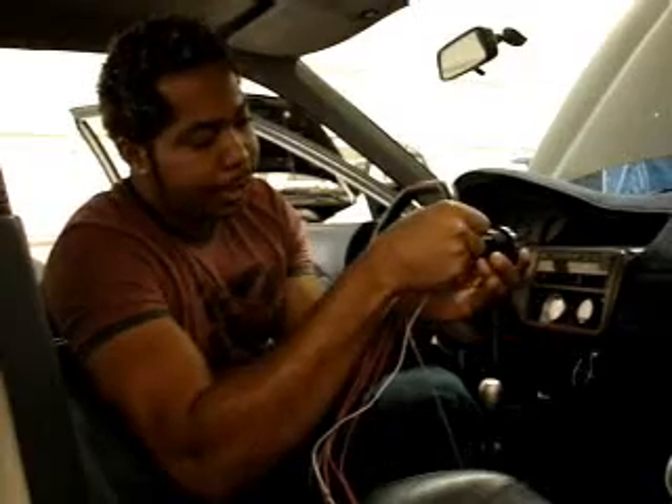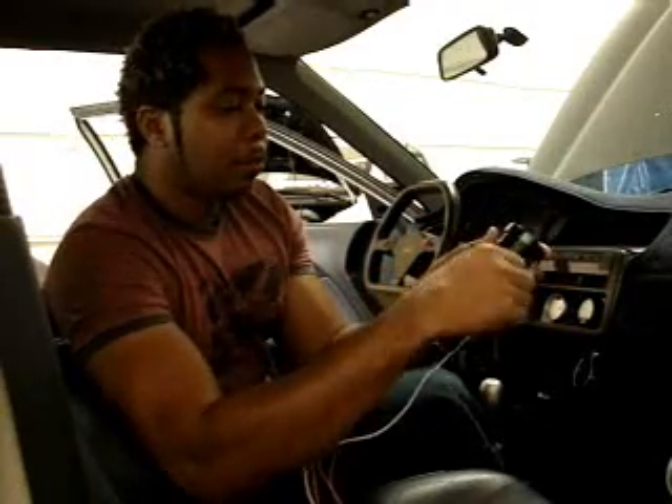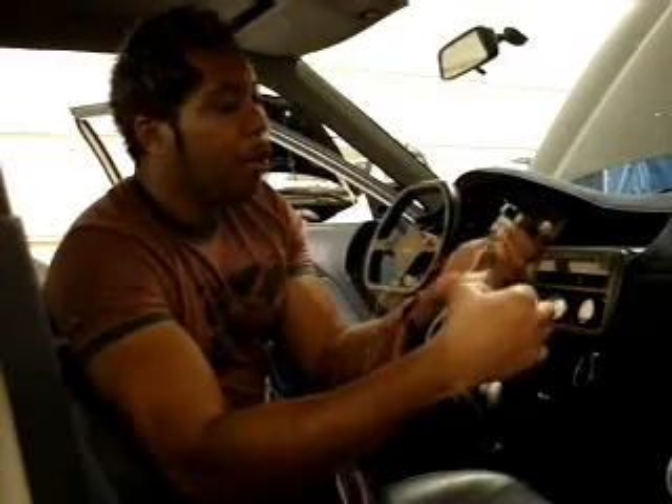All you have to do is take the harness — it's so color coordinated so it's easy to remember. White plug goes into the white receptacle, and it's that simple. The wiring is very easy as well. The two reds are easily distinguishable by color — they are the constant power positive sources. The two blacks are the constant ground for the wideband UEGO sensor.